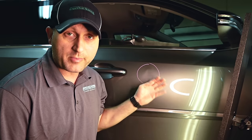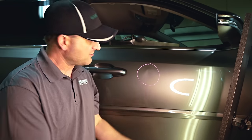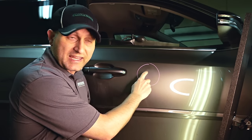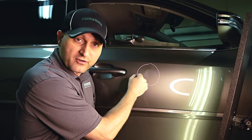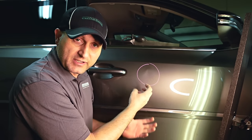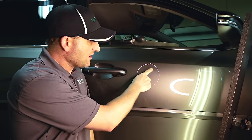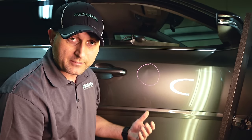The hot water or popping-the-dent-out trick is not going to work for something like this. With the glue pulling method, I could attempt to put a tab right in the center and try to pull it out, but those crowns and ridges hold the metal really tight — there's a lot of tension. This is a pretty soft metal — it's a Toyota — and I probably could move a little bit of it, but it would distort things and cause more trouble. If you don't affect the metal in the proper order, you run into the problem of not being able to fix it properly.